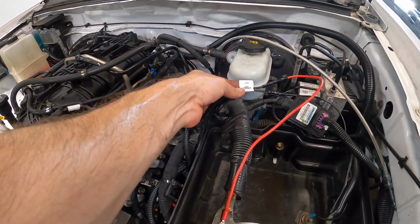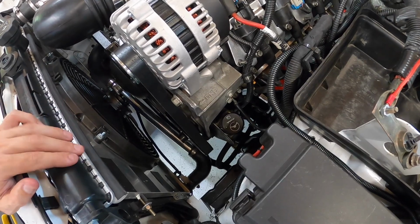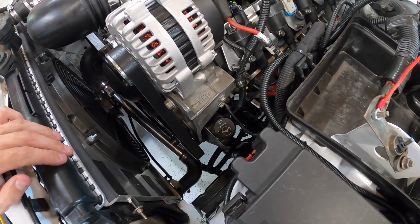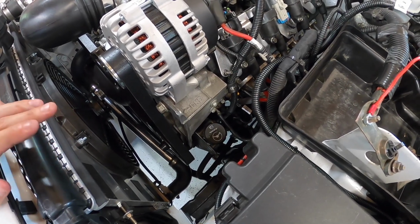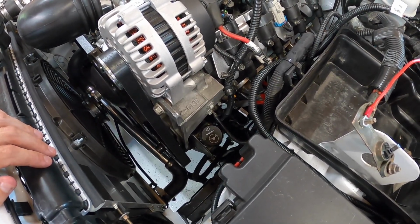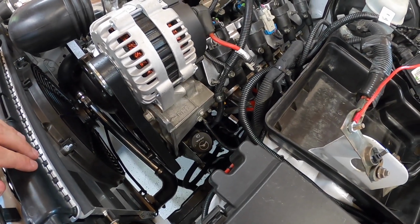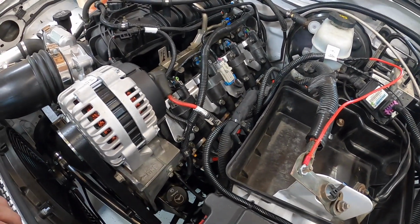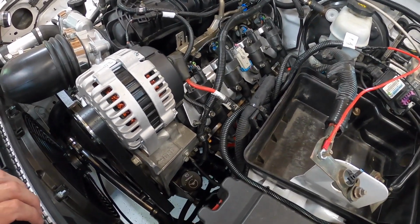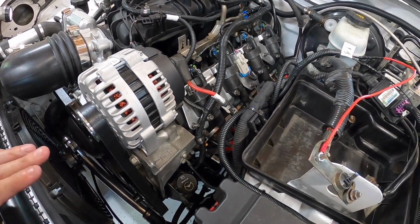Basically, the two bat wires go to the battery, the fan wire goes directly to the fan. You ground out the negative, and that's it. You're done. The ECU should control the fan cutting on and off based on temperature, so there's no need for that external sensor that I bought. So I both wasted money and wasted time, but I learned. So I'm done. Hopefully it's clear to everyone now.